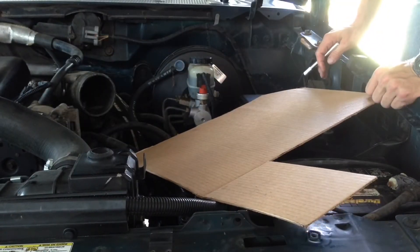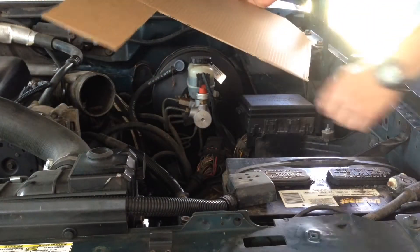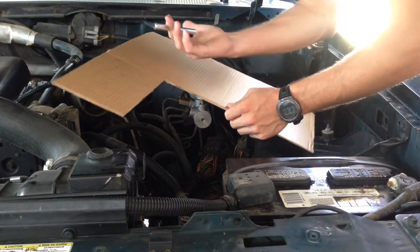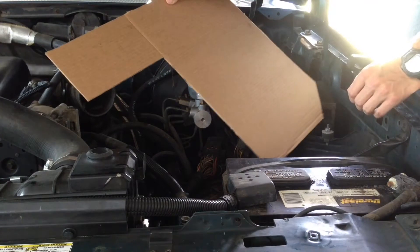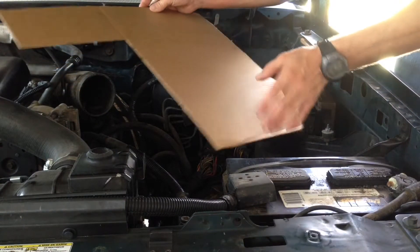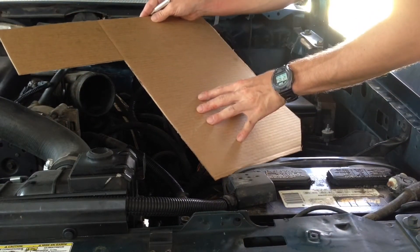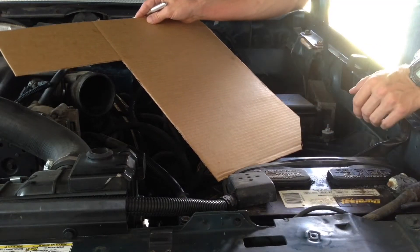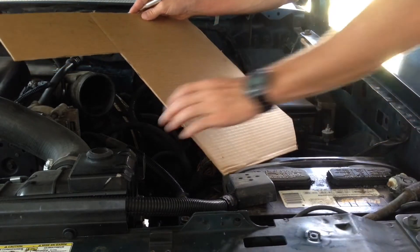This is the technique I'm using to mock out the shape of my air box — I'm using a piece of cardboard and an exacto knife to cut out the shape of where everything is going to be. What I'm going to do later is take the pieces I make out of cardboard, trace them on a piece of steel, cut it out, and weld it all together. At least that's the idea in theory.